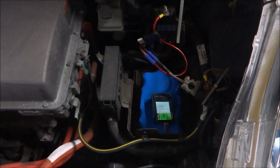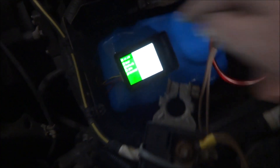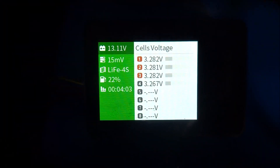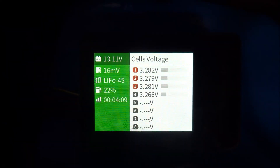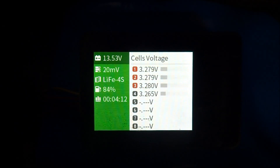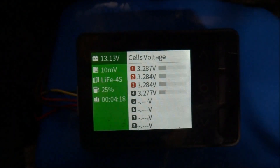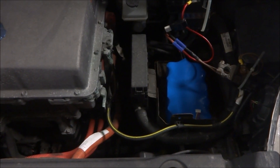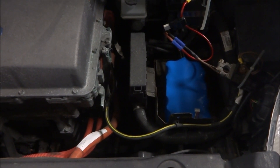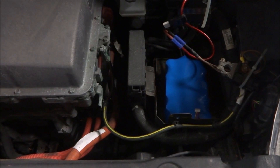The car has been charging for a few minutes now and I have the terminals tied up so they can't fall over. I've got a balancer plugged in and as you can see there's about 15 millivolts of imbalance. It's kind of strange because the voltage seems to be balancing — I guess that's how the DC-to-DC converter works, it pulse charges the battery. We'll leave this in the car for a little while. Obviously having a BMS would be preferable, but I'll be running it this way for a while and periodically testing the balance of the cells using an ISDT BG8S.